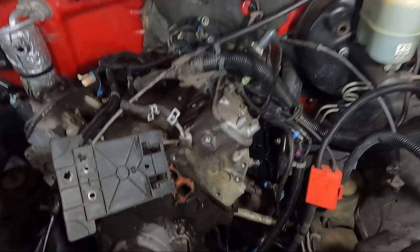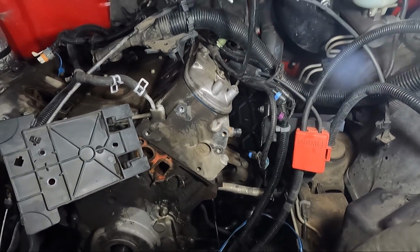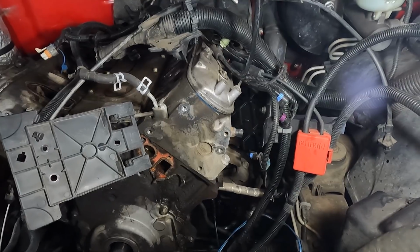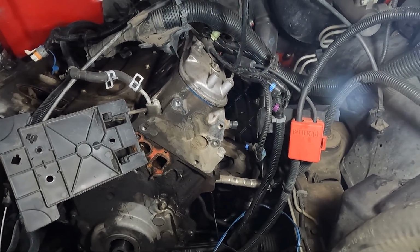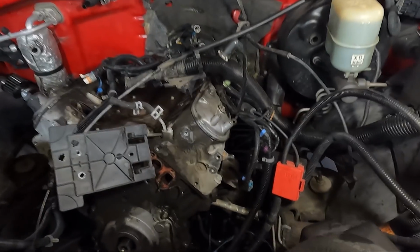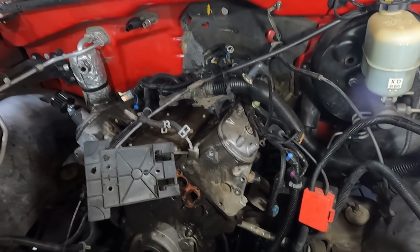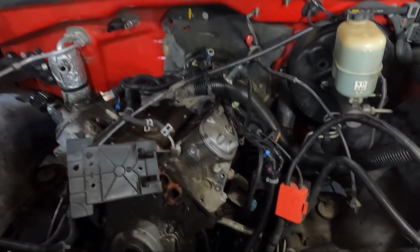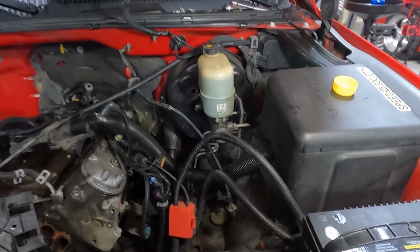So what we need to do now is, obviously we need to take the motor mounts out, which I'm gonna lift back up to do that. I'm gonna take the whole piece out as one unit, and you guys will see once I'm down there what I'm talking about. There's 2 18s that kind of go through there. I believe they're 18s, but in order to take it out with the harness on it, you got a couple different options. You can take it out without the harness, which means you got to go through and unhook all the pieces of the harness, which a majority of it is finished, but I'm gonna just throw the harness on top of it.